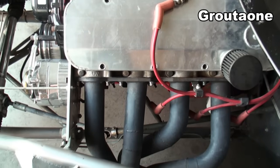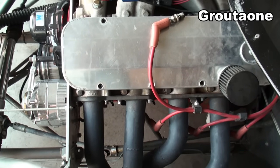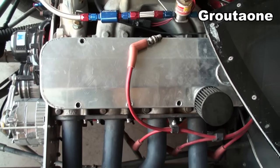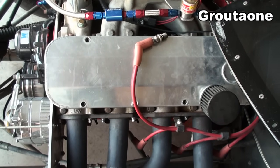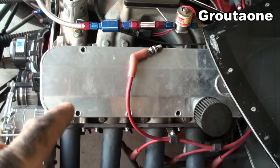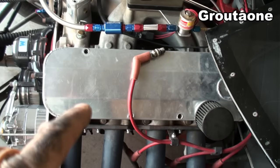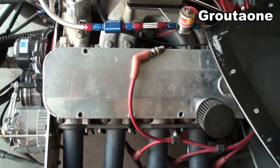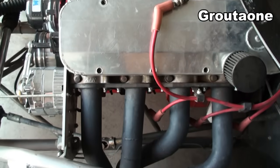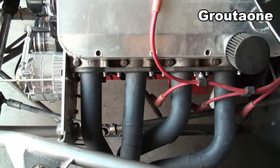But let's say I've got good spark — what now? Next I'd be getting curious about what's under that valve cover and also very interested in doing a compression test. I think I'd pull that valve cover off and have a look at the rocker arms and valve springs, make sure that all looks normal. And if that all looks good, I'd put the compression tester to it and see what I find.